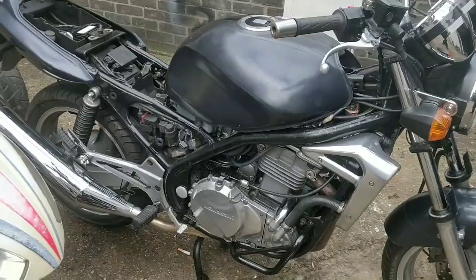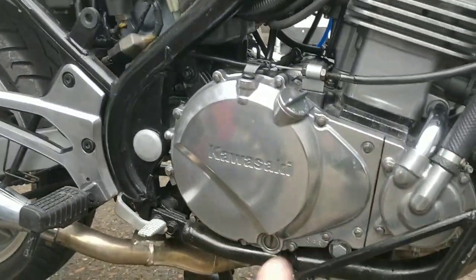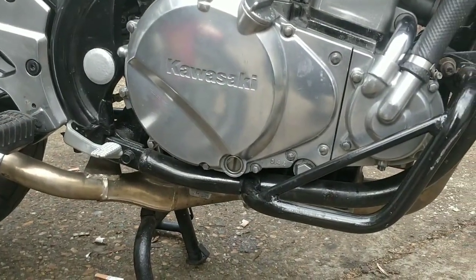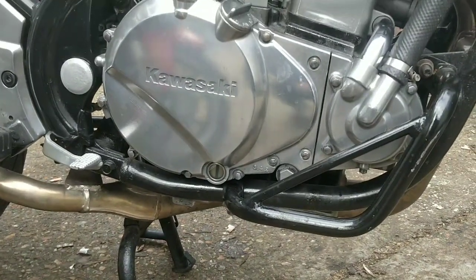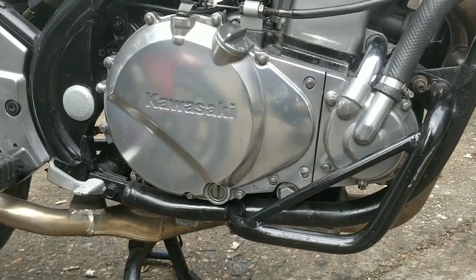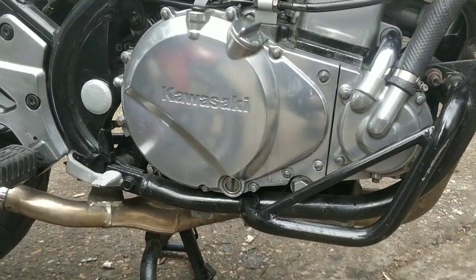Okay, the ER5, even in yesterday's video, even after all that boring filming, it flooded its oil again just before I went home. And me being me, I kept checking that window all day, didn't I? And at the end, it seemed to have risen. So I popped it, I leaned it left and right, and I thought, hang on a minute, it has risen. I dropped all of the oil, and of course, once again, there was fuel in there. So annoying, but I know what happened yesterday. I kind of got unlucky.